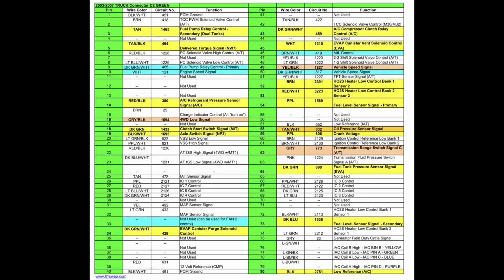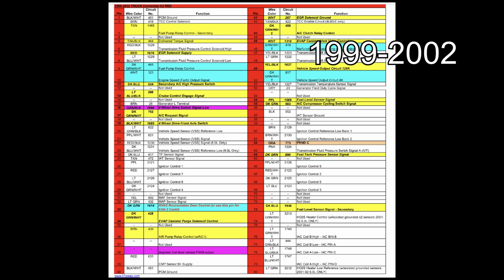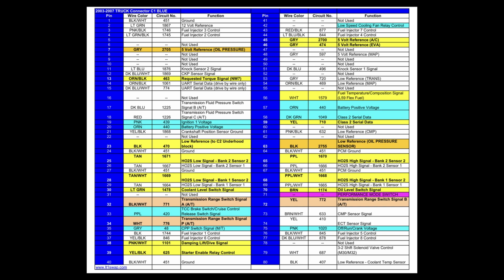To know which wire to remove, you're going to go on lt1swap.com. You're going to find these sheets. I'll leave a link in the description. And these are sheets to tell you exactly which wire you need to remove, which ones you need to keep. There's a blue sheet and a green sheet, both for your blue PCM connectors and for your green PCM connectors. And if you have an older style PCM with the blue and red connectors, there is a red sheet as well.